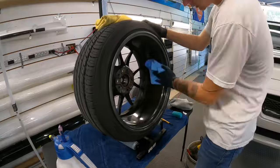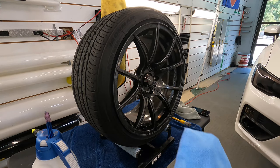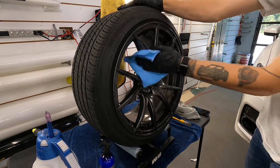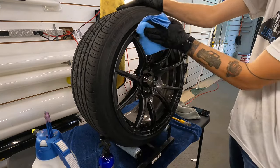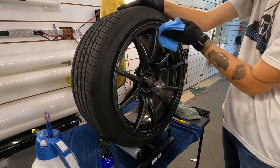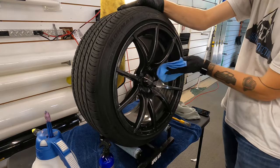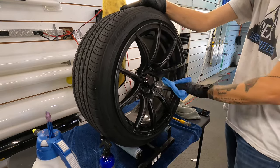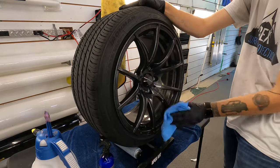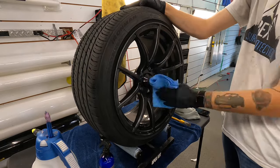Tip number nine: proper cure time. Whatever the coating is, the instructions will tell you how long to let it sit without hitting free-flowing water or driving the vehicle — keep it clean and dry until fully cured. I would definitely use a topper; BC3 is the perfect topper for wheel coatings, letting the coating cure and breathe while guarding it from whatever mother nature and the roadways can throw at the wheel. Infrared lamps, for those that have them, can help bake on the coating — especially useful for wheels, since everything you can do to help that coating will make it last a little bit longer.